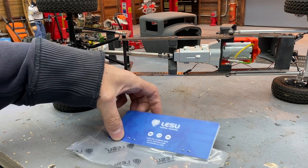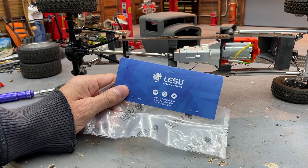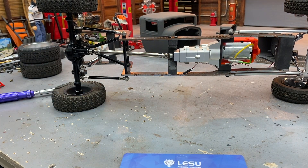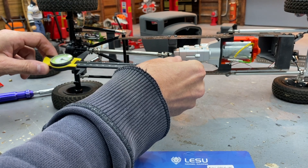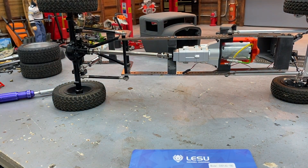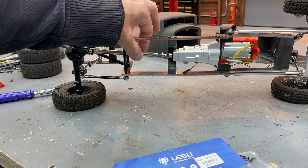I've used these on a couple of rat rods recently. You can find them on eBay — I found Semi Joe's Truck Shop, he sells on eBay all the time and has a web store now with these in stock in every length imaginable. Measuring isn't too difficult. This is a 140 to 180 — we're sitting at about 148mm pretty consistently, so the 140 to 180 fits perfect. I always go towards the longer direction so there's less slack and you get far less rattle out of the driveshaft.